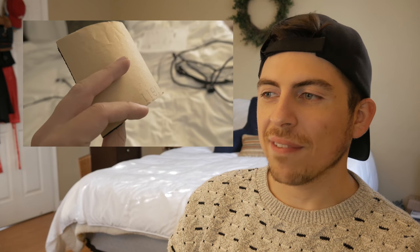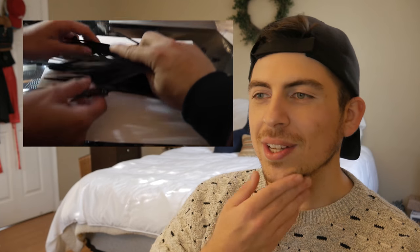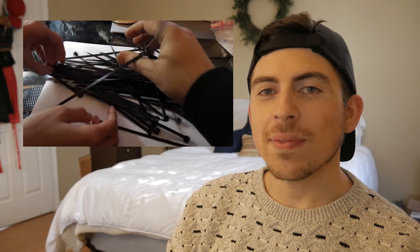That's all the harnesses. You also need cushion tape. Cushion tape is basically a foam tape that's an anti-rattle inside your fender, so whenever you install them, it doesn't rattle back and forth when you're driving, especially when you have bad bushings like I do. And you also need a lot of zip ties, so make sure you have some zip ties. And that's basically it. I'm going to cover the hand tools in a bit, so let's get to it.